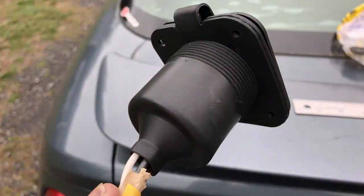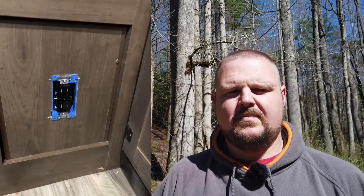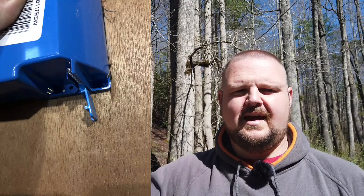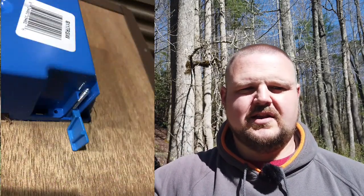In this video I just want to look at the power inlet, the steps to do that, and the mistakes that were made. The things you need are: a power inlet (I'll put an Amazon link below), some 12-gauge Romex wire, an outlet, an outlet box, and an outlet cover. The outlet box I got was for old-work construction — instead of nails to attach to a stud, it has little wings and screws, so you just cut a hole and tighten the screws, which fold out wings that clamp it to the wall.